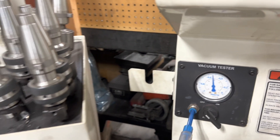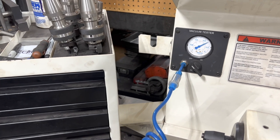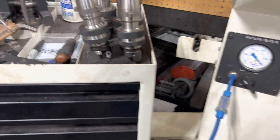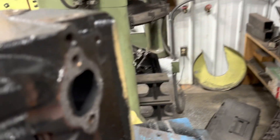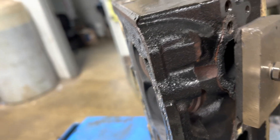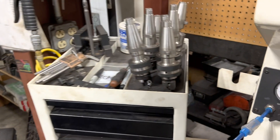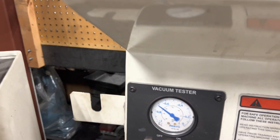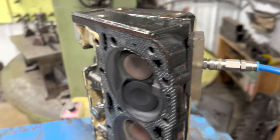That's acceptable. Should be actually better, but... So there you go. Check the exhaust. The exhaust kind of holds. So there you go — got a leaking intake valve.